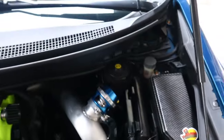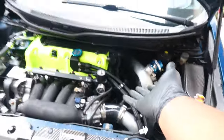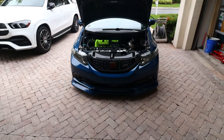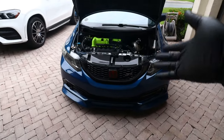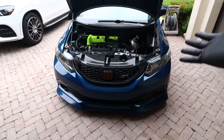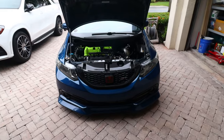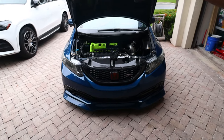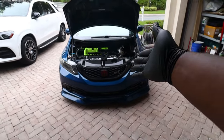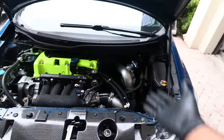I don't know if I told you guys recently, but my boost controller — hiding right there — I think it took a crap on me, because the car is only hitting wastegate pressure. It's not hitting anything higher than that. The most it'll hit is probably like 9.5 to 9.8 psi, which is basically wastegate pressure because I have an eight-pound spring. When the temperature gets cold at night it gets that high but doesn't go higher. I even upped the duty cycle to 40, which should push it way higher, but it stayed at that eight to nine psi.